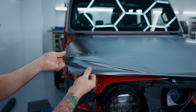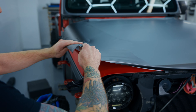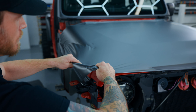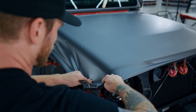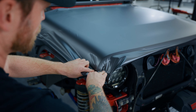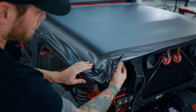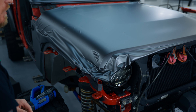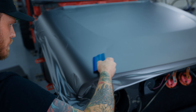I could elevate the hood on a box — that would help get it away from that hinge, but I didn't want to interrupt the video. Again, we're pulling hands over top — pulling, pulling, pulling, pulling. Right down. See this corner right here — these wrinkles look like they're leading towards an edge, but if I just pull them that way they go away. It's all about reading these and watching what's happening.